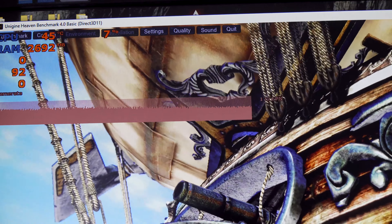That's about it when it comes to coupling two GPUs together in 2019 with PC games. It's really something that's getting less and less popular, and the reasons are obvious. Even when Crossfire was working properly, the 1% and 0.1% lows still gave a less desirable experience than a single GPU. Going with a single-card GPU will give you a lot fewer headaches than a two-GPU setup — and with three or four cards, you can expect even more headaches.